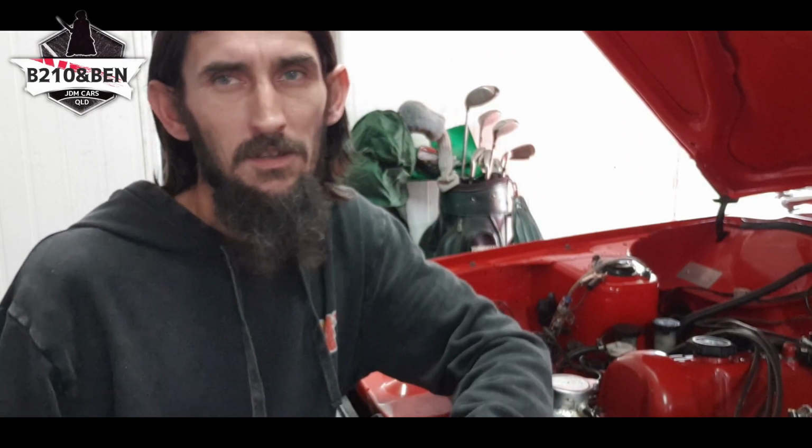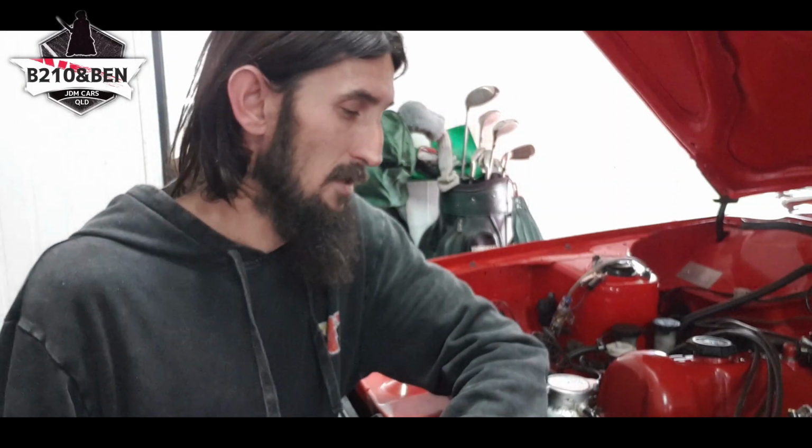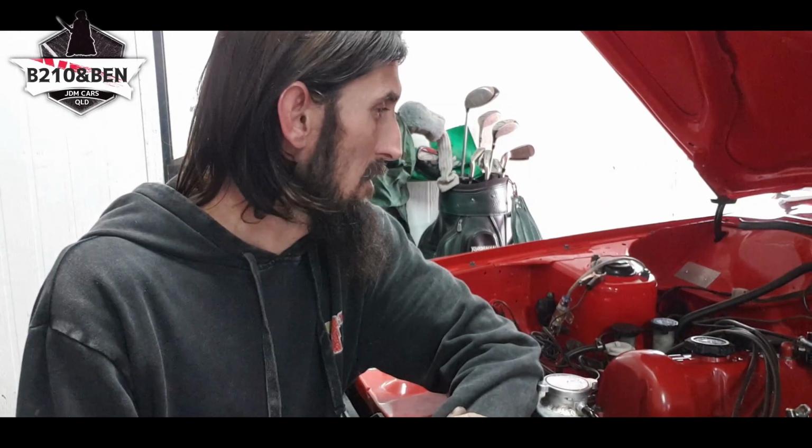So we've gotten a little bit less timing than I probably could have. It's back down to just above 10, 11 maybe, sort of. We'll see how it goes. If I've got to, I can just move it back up that little bit more. Hopefully that'll stop the ticking noise I'm getting. I'm pretty sure it's just, like I said, detonation. Stick around a second and I'll show you how high she revs up now.